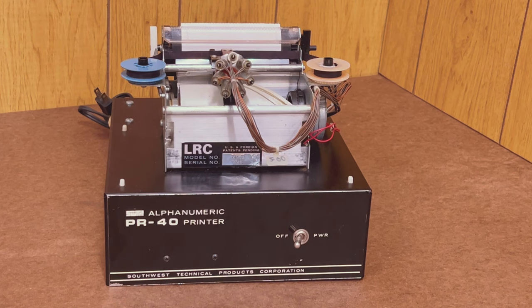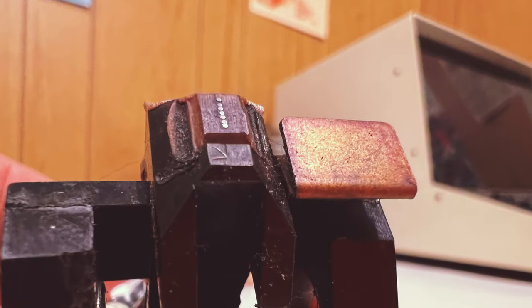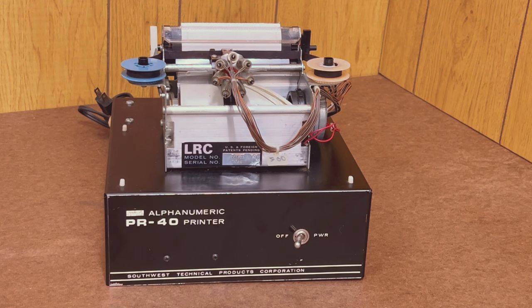First let's take a look at what this printer is. It is very simple in design and construction. The whole bit on top — the actual print mechanism — is a third-party part manufactured by a company called LRC. This mechanism was also used in adding machines and other commercial print systems, so it is not unique to this printer. It is an impact printer mechanism, the simplest version of a dot matrix design, with a single vertical row of seven pins in the printhead. The cluster of cylinders on the back of the printhead is the set of seven solenoid coils that drive each pin independently. As the printhead sweeps across the page, the electronics trigger the individual solenoids, which force pins to fire, striking the ink ribbon and then the paper, causing characters to appear.